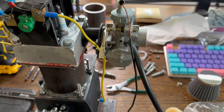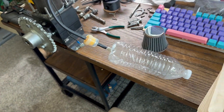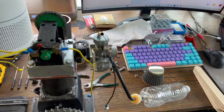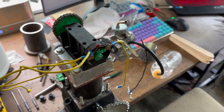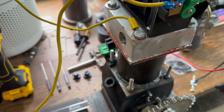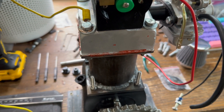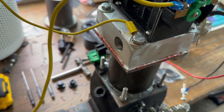The carburetor is all mounted up on the engine. I'll start with half choke. My fuel tank is going to be a water bottle — I'm waiting for a hot glue gun to heat up so I can stick it using popsicle sticks so it's gravity fed. I'll run two-stroke mix so it burns better. The new gasket is homemade — a cereal box cardboard wrapped in aluminum foil with RTV silicone between each layer.